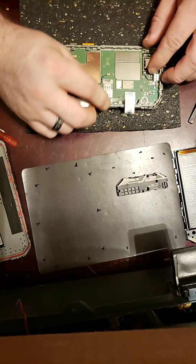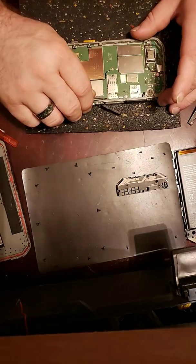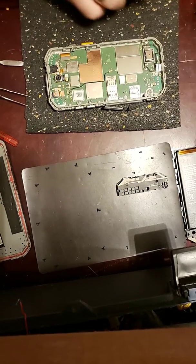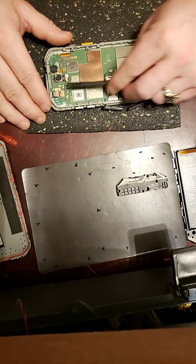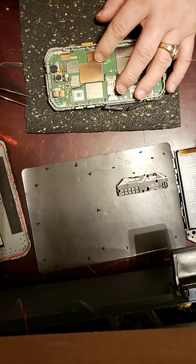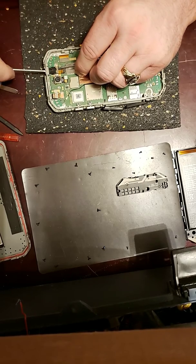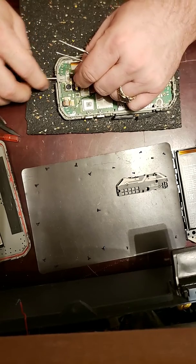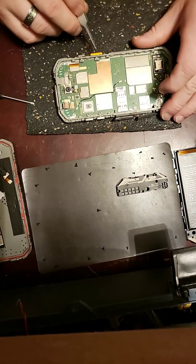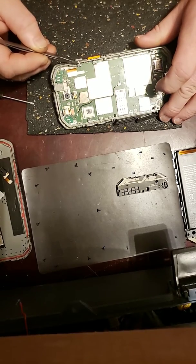There's a little card that slides out — those are the MEID. Don't lose that; it's important. Your doors aren't necessarily removable; you can finagle them out but they're not designed to come out. Here you've got the connector for your forward-facing camera, here's the connector for your back camera, and this connector is for your headphone jack — it will actually pop out, and the headphone jack is easily removable. If you ever need to replace the headphone jack, it's right there. Buttons are super easy to remove and put right back in, and they do have waterproof seals.